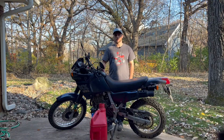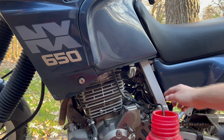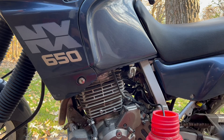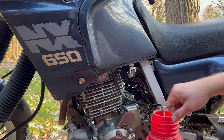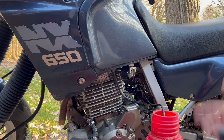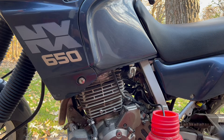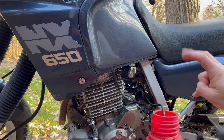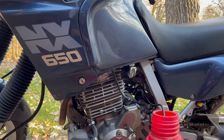It's just a matter of taking your existing fuel line, using a flat blade screwdriver, and opening up your carburetor drain screw. We've got our existing fuel drain line, taken from its original passageway underneath through the swing arm, and plumbed it into our gas can. We opened up our fuel drain screw and left our petcock in the reserve position. We took our gas cap off to give the best flow we can. We've got it outside with plenty of ventilation, and I'm just going to let this run while I take care of other tasks. When it seems done, I'll stand the bike up, lean it side to side, and shake it a little — that'll often reignite the fuel flow and get some extra fuel moving.